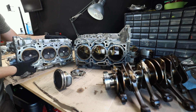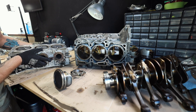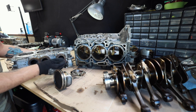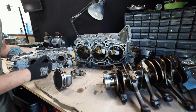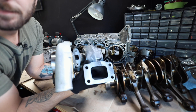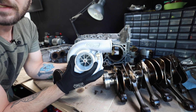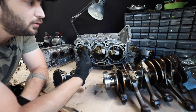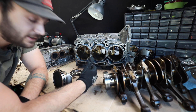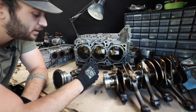After the explosion, the exhaust valves open and let all that exhaust gas out through the bottom of the cylinder head, into the exhaust header. If you're on a turbo application, that exhaust gas then spins your turbo's impeller wheel, sucking in more air and making more power. All of this works together very smoothly, and once you start disassembling and understanding the engine it's not as complex as it seems.